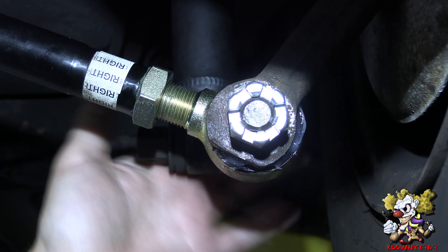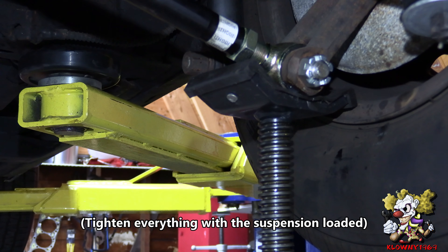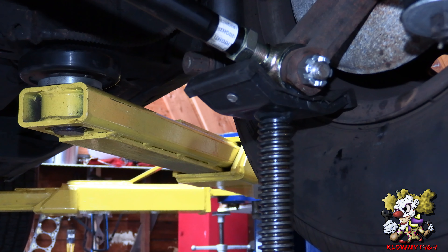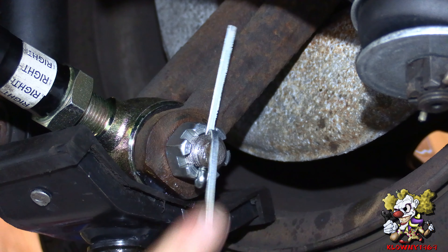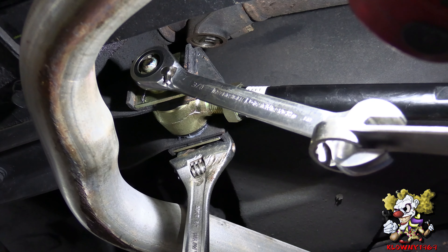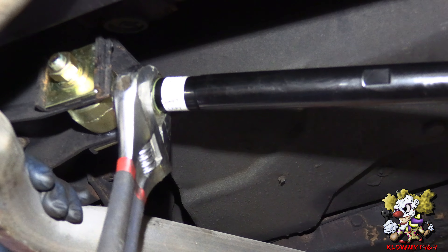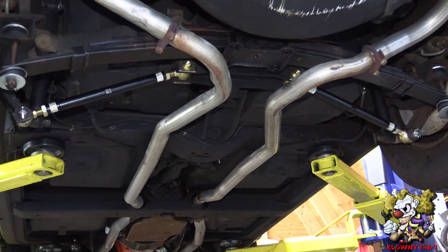When you put this on, you might want to use a smaller hammer to tap it in. Put a little blue thread locker on the threads. I also put this on its weight, so I lowered the suspension. Go ahead and tighten this down — that's good. Now insert the cotter pin in the hole and bend it over, cut it here and there, and you're done on this side. Put some blue thread locker here too and tighten that down. Tighten these nuts — both tight, and we're good. Now all you've got to do is go get an alignment. Thanks for watching — subscribe to my channel, like and share.